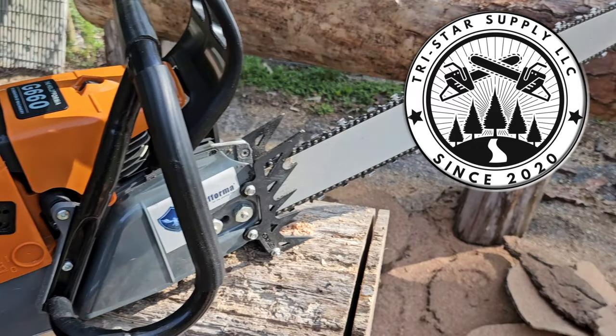It really is. But I do have to get back in there. That's the whole name of the game whenever you're figuring out a saw and what to do. A little bit of this, a little bit of that, give it some more power. I'm wanting that thing to have higher RPMs. And I definitely think that it's being held back by probably two things. Number one, those upper transfers, I need to raise them. Number two, the ignition timing. So we'll hit those. And the next time you see this thing running, it'll be with all the little tricks that I do to it to make it faster and stronger.